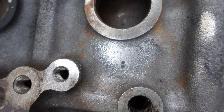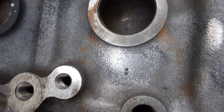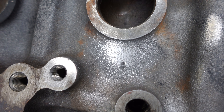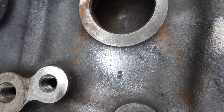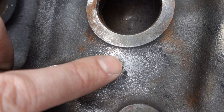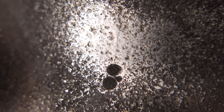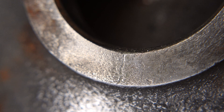I was having a lot of trouble seeing the crack after I hit it with the wire wheel — it essentially polished the surface. What I did was take some sandpaper and sanded it to dull out the surface and create some powder dust that would get into that crack so you can see it right there. Essentially I did a little at-home Magnaflux without Magnaflux powder and without magnetism. Sometimes you can use different light colors to your advantage too — once you change the temperature of the light a little, you can really see that crack and see that it goes up to the freeze plug bore and back down to those two drill marks.